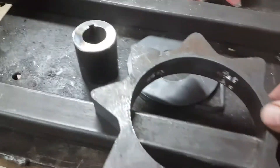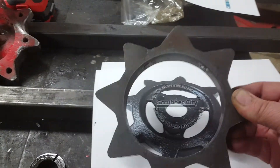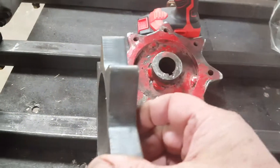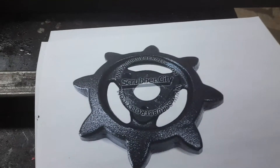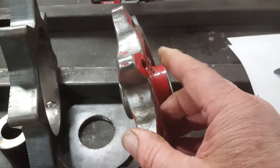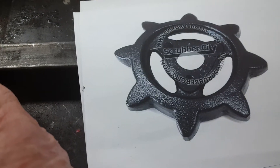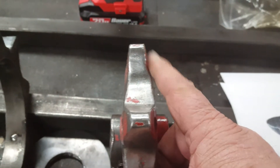I took that sprocket to a machine shop and they copied it. What I got from the machine shop is a 60-pitch sprocket made out of 7/8-inch steel. My original Honda-powered sprocket was one inch thick, so I had them cut it at one inch. But then I found out the teeth are tapered to the inside at the top, so I went ahead and cut it down to taper it to match the tracks better.